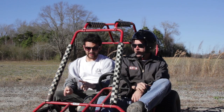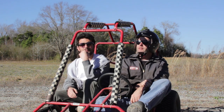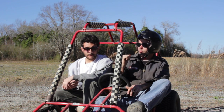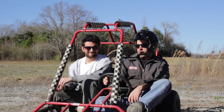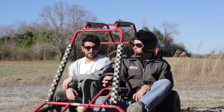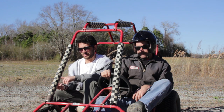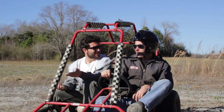That's all we got for this one guys. We modified the steering for a much better turning radius, stiffened up the suspension, and combined with the performance modifications we made before, this thing is actually turning out to be a pretty solid go-kart. It's not fast, but it's fast enough to hurt yourself. The next thing I'd like to do is the torque converter — either work on this one or get another one — and then a different power plant. Personally I'd rather go with a modified Predator 212 from Go Power Sports, but a diesel would be awesome. John wants to do a dirt bike engine — maybe a two-stroke.